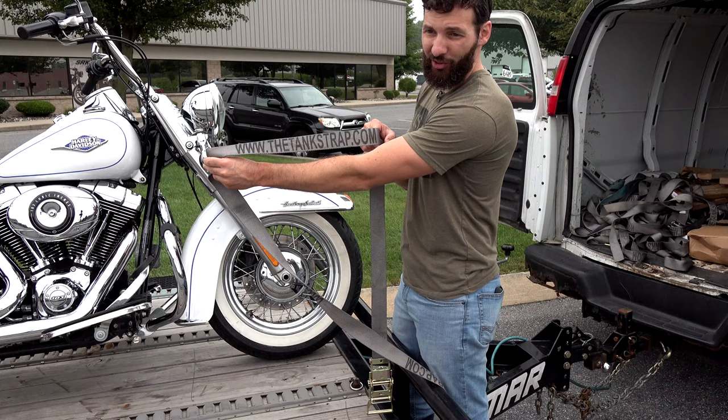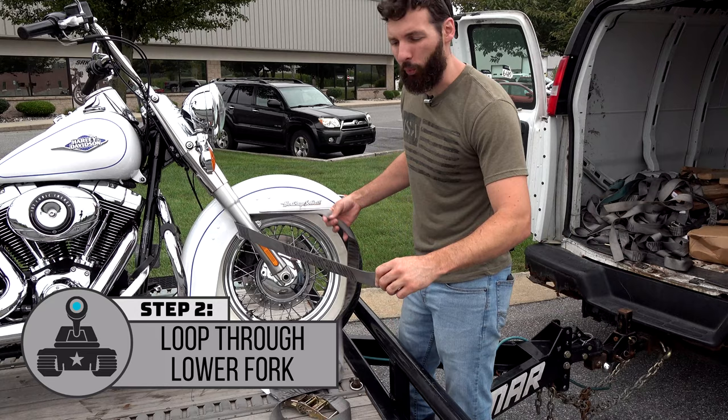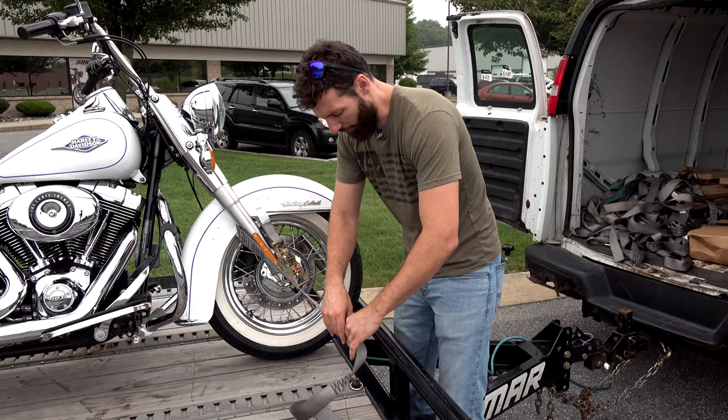The unique thing about these straps — these are M1 Moto Tank Straps, you can go to tankstrap.com or Amazon to buy these. The way we do this is this is unsprung weight. So instead of cranking on the suspension and tying it down as hard as you can, which is tough on the suspension, we get below the suspension so the bike can kind of bounce around — the top end of the suspension can do what it wants. Whenever you wrap it around something, make sure it's not going to move or slide in anywhere.